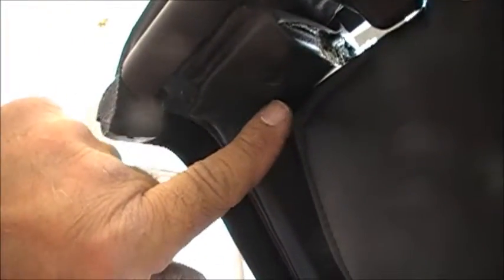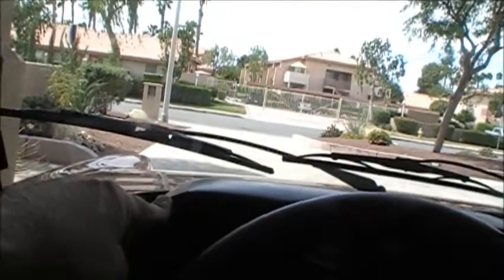Back inside — I knew there was another screw in here. I've pulled out the little plastic caps. There's where the third screw was, up underneath by the sun visor. Pull out these three little plastic caps — you'll need a fine tip, I believe it's called a Torx point on these. Take out the three screws, pull back the weather seal at the top just a hair, and the pillar will pull up and out, exposing the pillar. I also found a couple more nuts inside, one on each side of the gauge bezel.